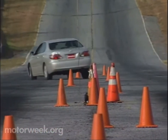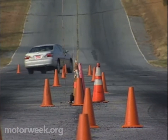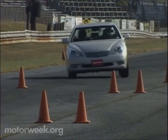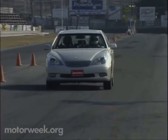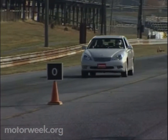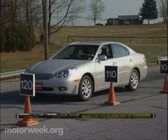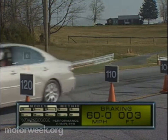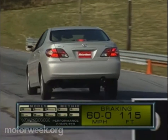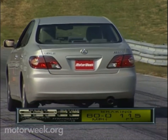What was surprising was the steering system also lagging behind in our over-and-back high-speed lane change. This unusual occurrence made this avoidance test a little more dramatic, taking extra muscle to steer the car back into the proper lane. There was no drama, however, when it came to stopping. The ES300's four-wheel disc with ABS and electronic brake force distribution brought us down from 60 in an excellent 115 feet. Brake assist is also included as part of the skid control option.